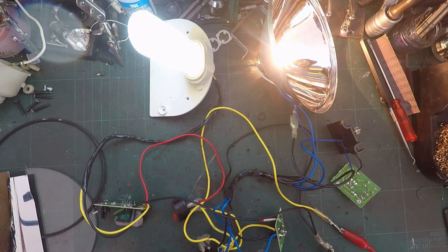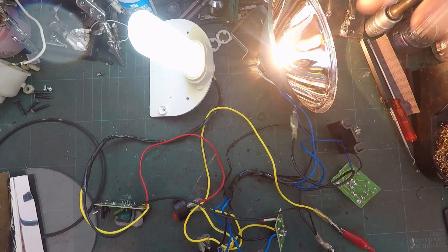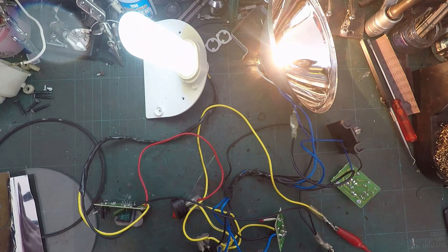Obviously I had to disturb something long enough for it to come to life. There it goes! Well clearly the plus and minus on there are correct then, because it is now working as intended. And that was the part that was in the amber bit - so we've got amber flashing, main light, sort of work-light thing. I don't think any of this is ever going to go back into that light, because there doesn't seem any point. I think converting the whole thing over to LEDs would make far more sense, and I might convert it to 12 volts instead of 6. Because if that battery's dead and won't take a charge, we might as well change it to lithium iron, go straight to 12 volts, and then we can power bigger LEDs with no problem at all.